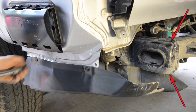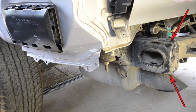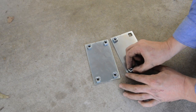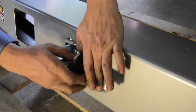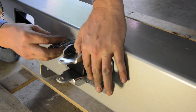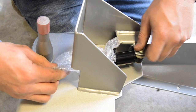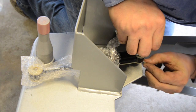Finally, check the welds on the top and bottom of the chassis rails. If they're lumpy, grind them down and touch them up with some black paint. It's now time to prepare and fit the new bumper. Begin by fitting the supplied cage nuts to the backing plate, then loosely fit the hook plates to the bar. Then fit the body ends of the gas struts into the mounting bracket inside each top wing of the bar using the supplied clevis and split pins.